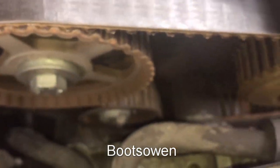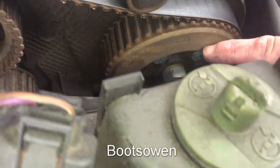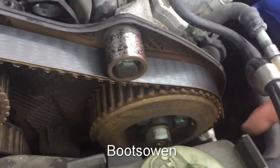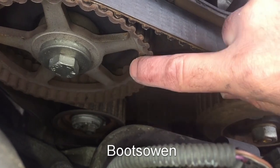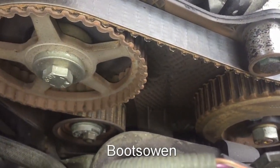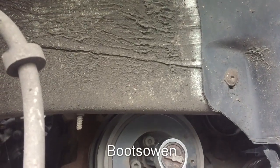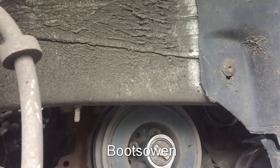That's got loads of cracks in it. We've got an injector pump and an injector pump belt. Three screws around the outside but we never loosen the center one. The tensioner is in here and this is the camshaft pulley up here. There's another idler down below somewhere. This bolt in the center is on the end of the main crank and it's got a 19mm head on it.